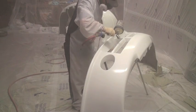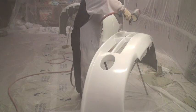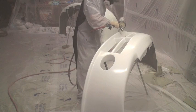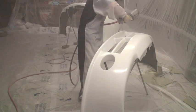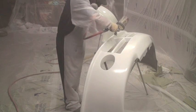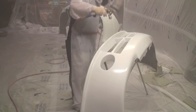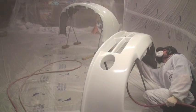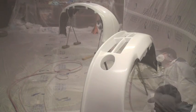Now when you're applying your clear coat, the best thing to do with bumpers if they have little pockets — you do the little pockets first. Clear the little tiny pockets, get all in the little crevice areas. That's the only time you're going to need to hit those pockets. You can get it from underneath them, get them from the back side. And then you can start your normal coats.